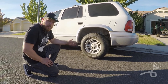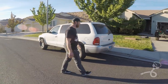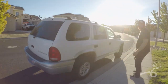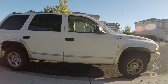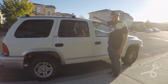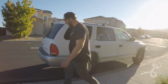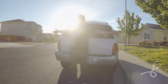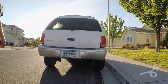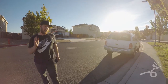I've already bought some lower links — those are going to be 38 inches eye to eye, which is a good medium for something built this big. She's a beauty. It's short — it seats seven but it's short, so the center of gravity is naturally low. It's not that wide, and it's really no longer than a stretched out JK. Coupled with the stock 5.9, we've got a really good starting point. I want to thank my little brother Jeremy — he's the one behind the camera today.